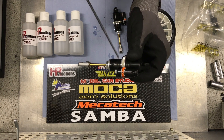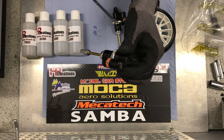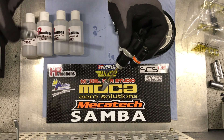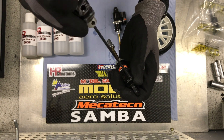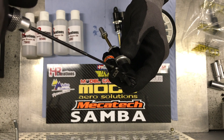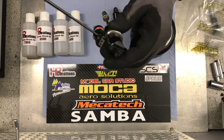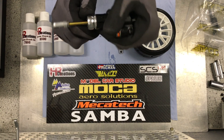The very important thing here is: if there is any air left inside the shock, the air will of course go to the top end of the shock. Therefore we have to keep the screws at the top level of the shock — at maybe 45 degrees or so. Both screws are the same, so whether you go with the left or the right makes no difference. We will just take the screw out — and there will be a lot of oil — boom, like this. Then insert the screw again, tighten a bit, and do a bit more. Like this. So now it is all filled.